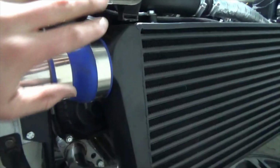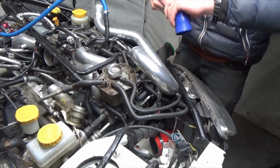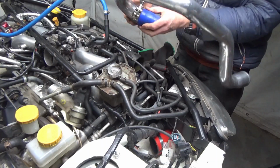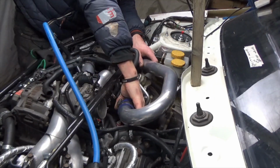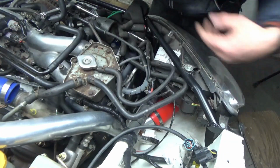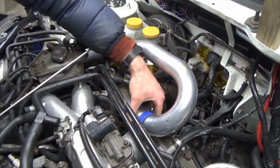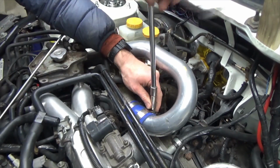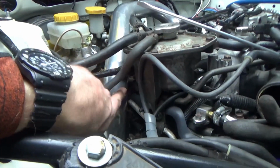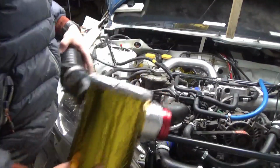See, the intercooler pipe protrudes out to the front of the car. Ideally, I want to push it into this join here as far as I can. The same on the other side, really. This is to allow space for the grill on the front bumper. Surprisingly, there is a good amount of clearance around this pipe. The worst area is along the side of the engine around there. Next, I'm going to get the air intake in place just to see what room I have left.